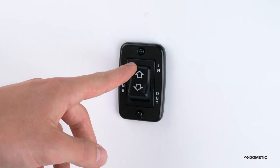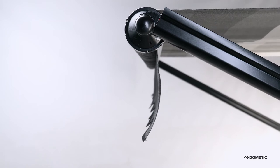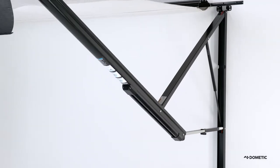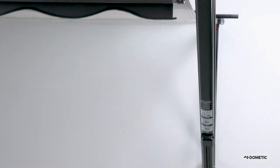To correct these conditions, press and hold the up or retract button on the awning's toggle switch to back the awning up until the valance hangs straight down. The hardware arms resemble a bent elbow and the valley is gone, leaving an awning position more suitable for water runoff.